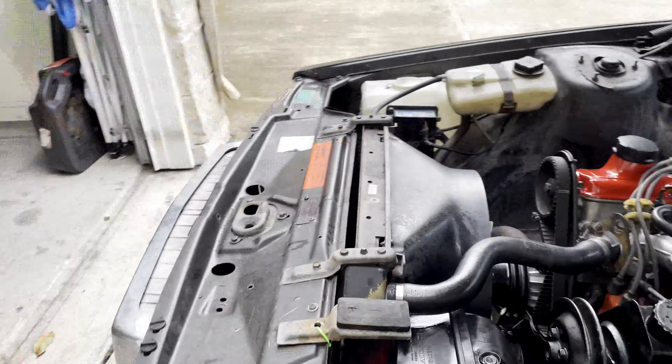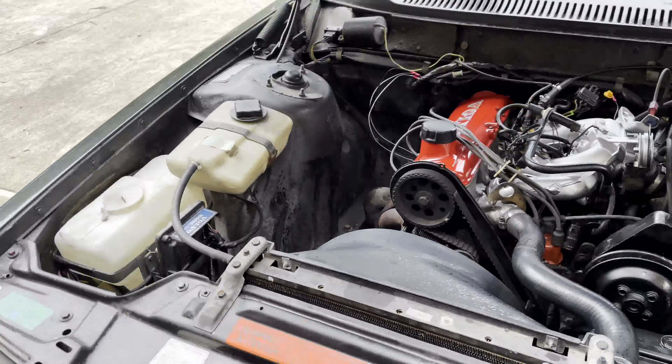The clutch should be here today, so I'm just doing some little things. Painted the valve cover to match the block, got the fan and the radiator back in, got the air box in, but I'm still waiting on that mass airflow sensor. I'm gonna go buy some vacuum lines so I can put all new vacuum lines in. I still need to hook up the vacuum advance because right now it's just unhooked and it's gonna run rough without a vacuum line and a mass airflow sensor.